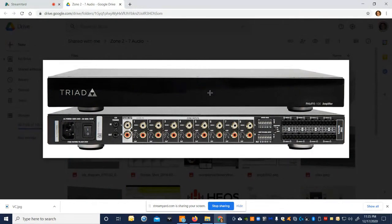With Tidal, Qobuz, Apple Lossless, and other high-resolution streaming sources, amplifiers like this let us deliver more than just background music — it sounds good at low volumes, which is really important, but crank it up and it really stretches. I used this amp on a pair of Sonance Voyager 82 eight-inch two-ways. We bridged two channels so 50 watts at 8 ohms becomes 100 watts at 8 ohms — 200 watts at 4 ohms — and I couldn't find the limit.